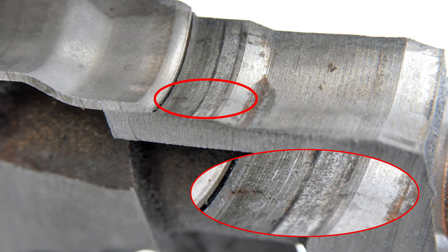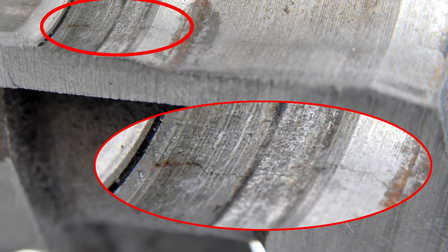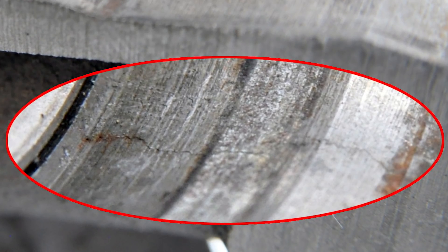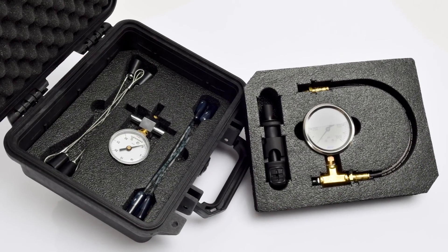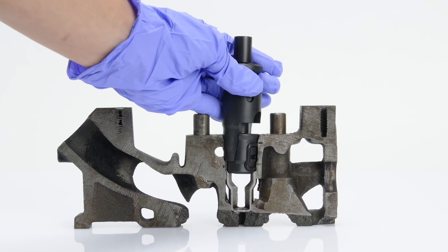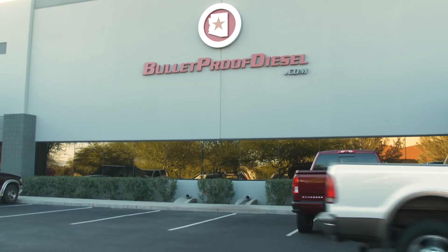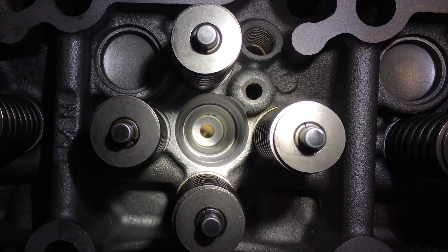There's another potential problem related to the 6-liter cylinder heads. Cracks can develop between the head's injector bore and the coolant passage next to it, which can lead to fuel mixing with the coolant inside the engine. Bulletproof Diesel provides two different solutions for cylinder heads cracked in this way. The Bulletproof cylinder head repair tool is available via mail order and can be used with the cylinder heads still in place on the engine — it's inserted directly into the injector bore and seals the cracks for a reliable repair. The second solution is only available at the Bulletproof Diesel facility, where they sleeve the injector bores in a process that allows the stock fuel injectors to be retained.